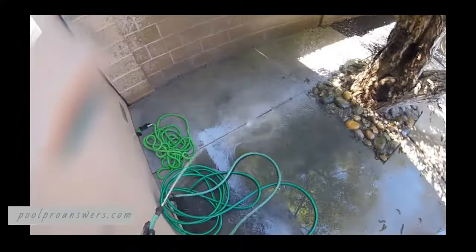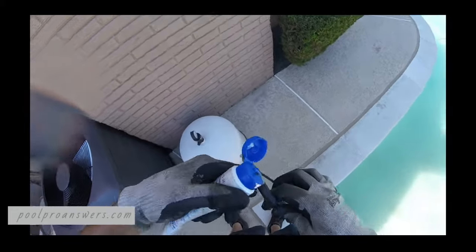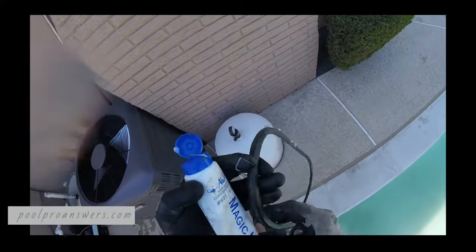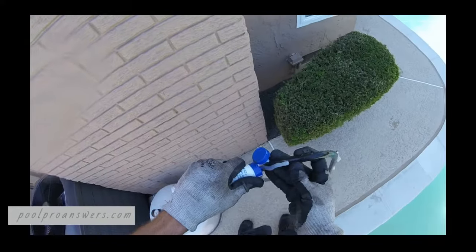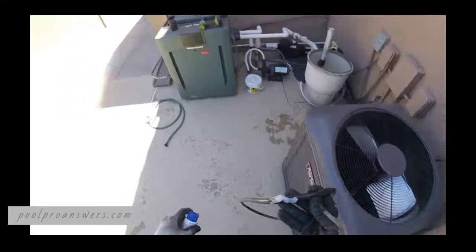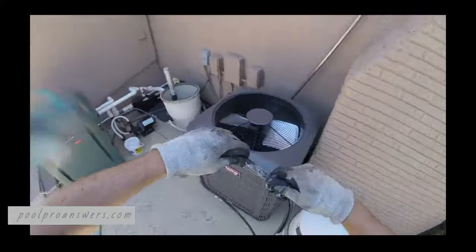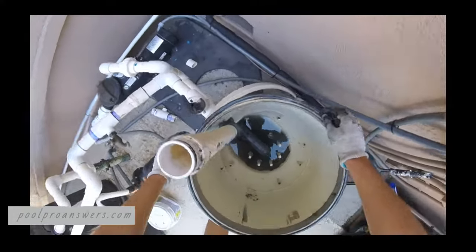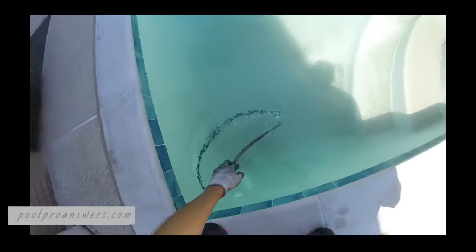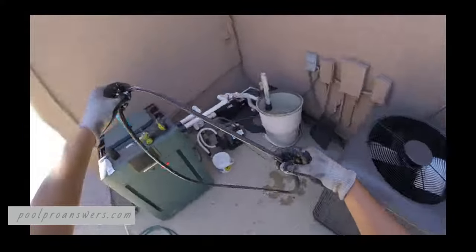Make sure you clean this stuff up because it'll look pretty nasty. The first thing I like to do is get some lube on the main O-ring here. The O-ring looks pretty good — inspect it for any cracks, because cracks will cause it to fail once the thing gets under pressure. You see how it's a little bit big right there? Let's see if we can shrink that up with some cold water. Don't worry — cold water will not wash off the silicone; silicone is not water-soluble.